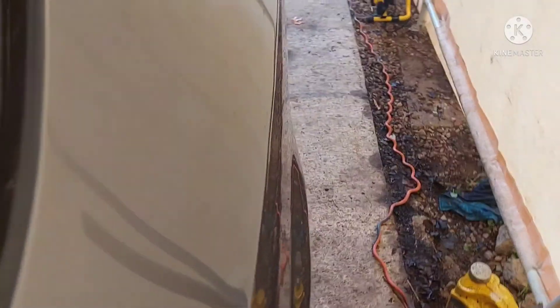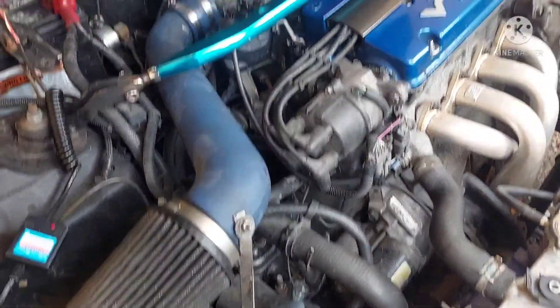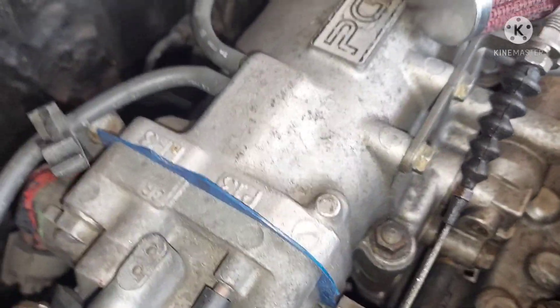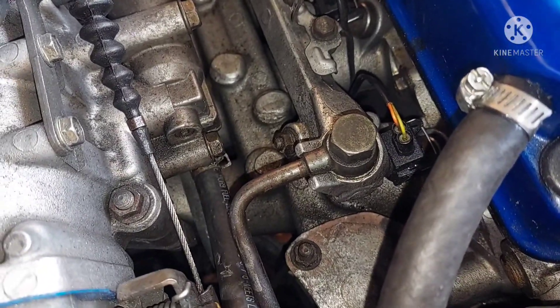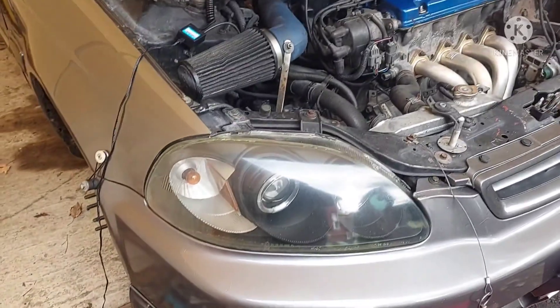I'm going to throw the Toyos — the Toyo triple 8s — on there. Check and make sure no bolts are loose because these solid mounts tend to shake everything. I had to make a gasket that would eliminate transfer of the vibration, and then go to eBay and get the thicker intake manifold gasket that bolts to the head to help with all the vibration. Having all these solid engine mounts plus the traction bar mount — the trade-off is the vibration.